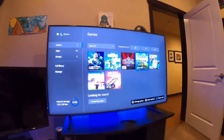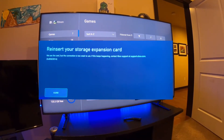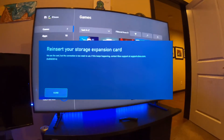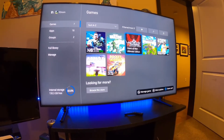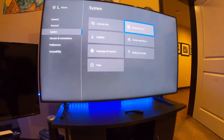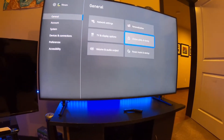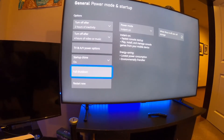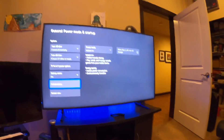Pretty good card, I think. There was an error we got that said — what did the error say? It said please insert, the connection's too weak. So in order to fix that, we had to go to Settings, then General, Power Mode and Startup, and then do a full shutdown. We rebooted it all the way down and then reseated the card, and that error cleared when we came back.